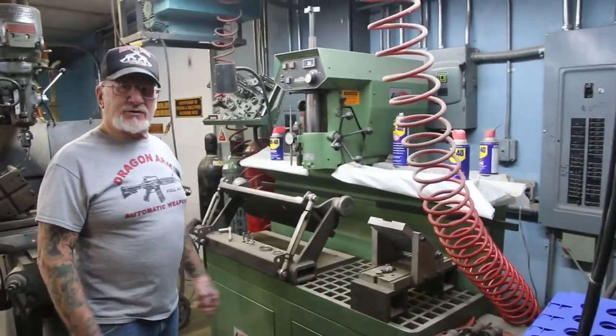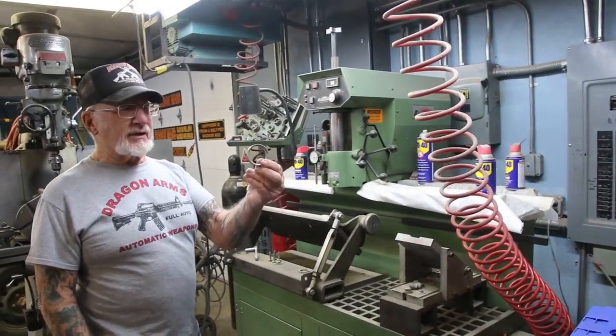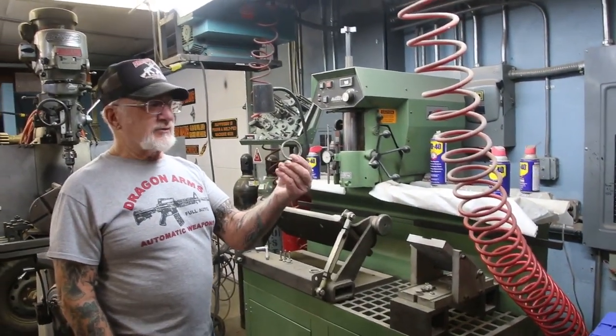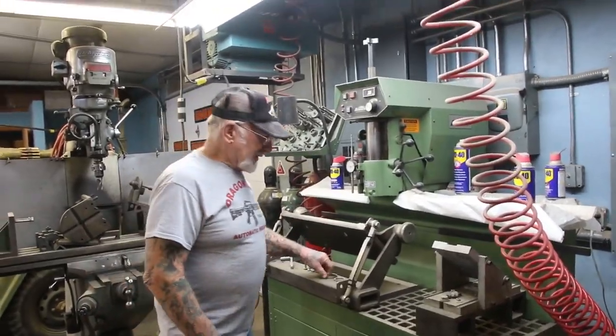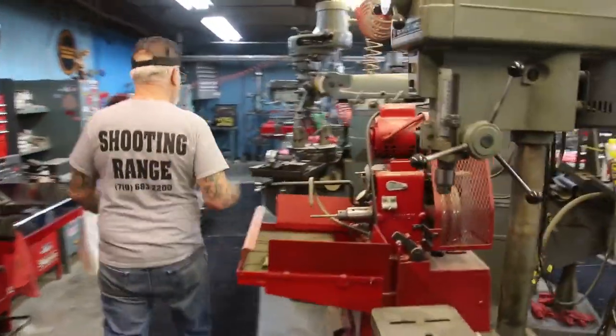This cuts out the old seat. We put in a new nickel alloyed seat, 80% nickel. You can't even cut them with a torch. These should last a lifetime. Okay, and you come over here. I rebuild my own connecting rods. We hone out the valve guide holes on this one here.